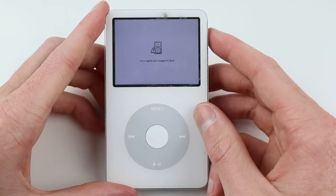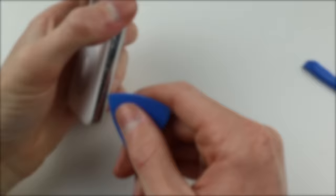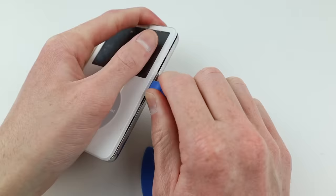There are various sad noises coming from that mechanical hard drive, so that will definitely need to be replaced. When replacing the drive, there are three options you can really go for: a replacement hard drive, a compact flash adapter or SD card adapter which is ideal for up to 128GB, or an mSATA SSD adapter where you can put up to 1 or 2TB in an iPod Classic.